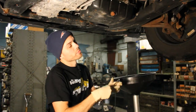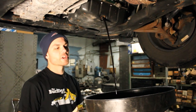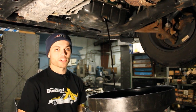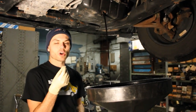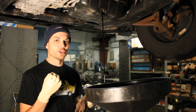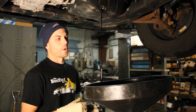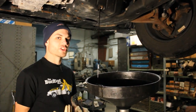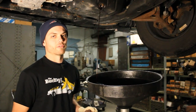One piece of information that's really good to know is the darker the color of your oil, the more miles you've put on it. So if it's really, really dark, that means it's a good time to change it. If it's more of a clear brown or tan color, that's actually the color of most new oil — almost like a yellowy light brown. If that's the case, chances are your oil is pretty fresh. However, it's always good to give an engine new updated oil, which ultimately will help with the longevity of your engine and lasting more miles.